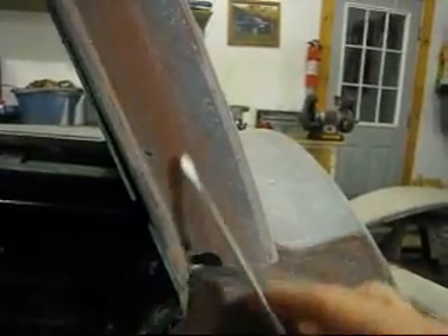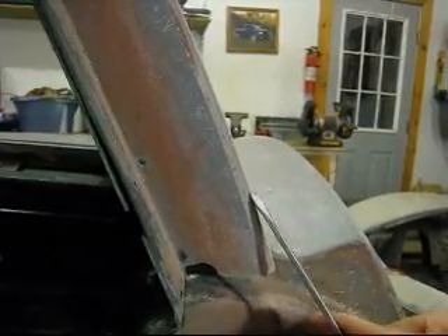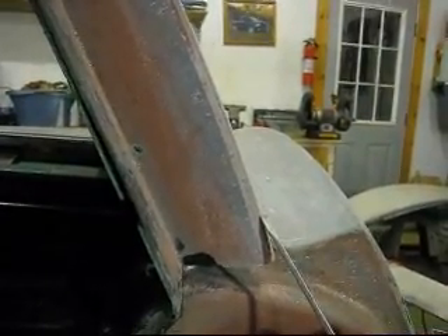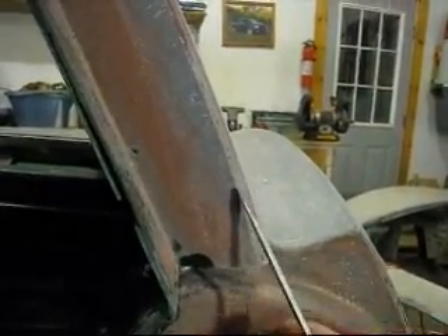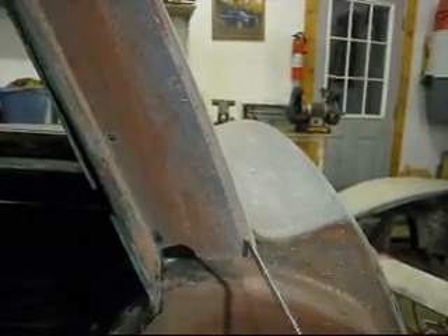After sanding, we can see that here is one section of the fiberglass shown by the darker area, and then also the darker edge here, which is basically a portion of the rear deck. The lighter compound in the middle is the bonding compound. This is really where we want to focus on starting to split these two pieces apart once we've applied the heat.